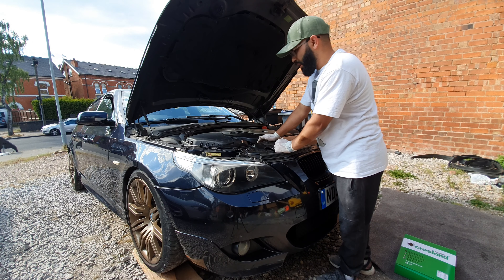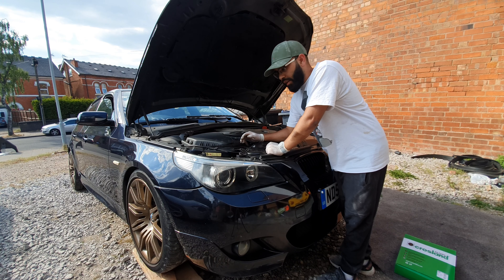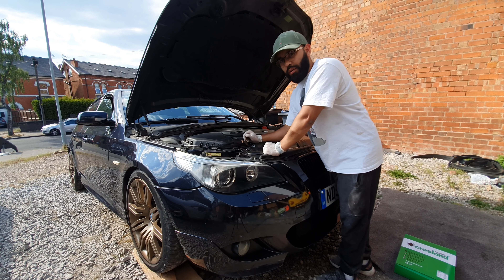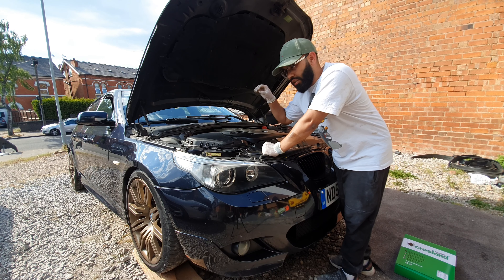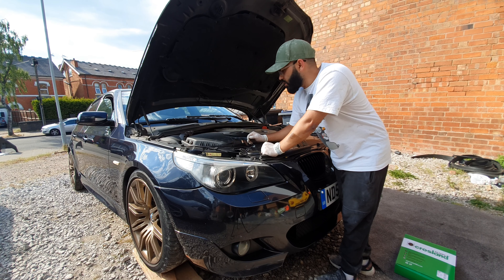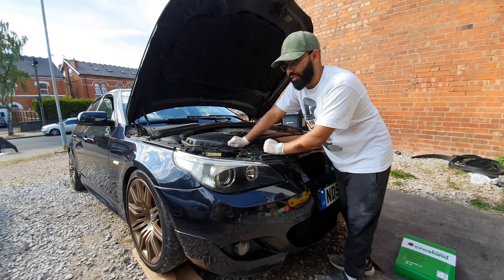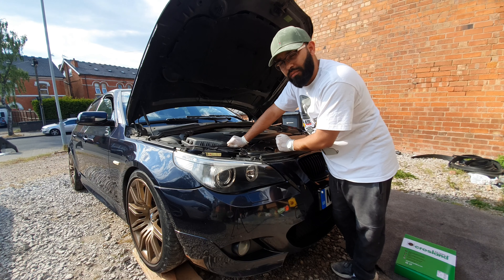That's it really with regards to the 535D — it's going to be similar with the 525 and the 530D engines, basically the same thing. It's a basic quick service on these cars. Glow plugs and those kinds of things are a very long job and they don't really need changing unless you have a problem. Air filter and engine oil — the car's going to sound and feel happy. Just top up the engine oil on a level surface, up to the right limit. I believe it's 7.5 liters, so maybe fill to about 7 liters and then fill the other 500ml afterwards. I hope you all enjoyed this video — please leave a like if you found it helpful, subscribe if you want to see more car content and DIYs like this, and leave me a comment if you think I could have done anything better. I'll see you all in the next video — peace out.